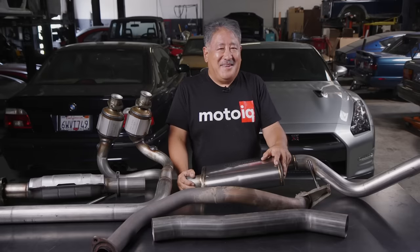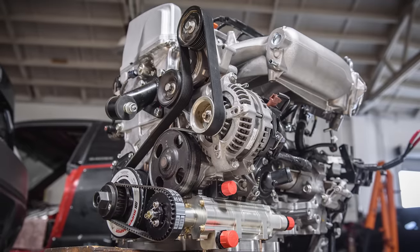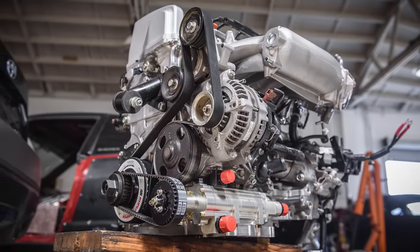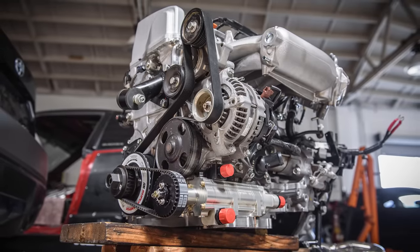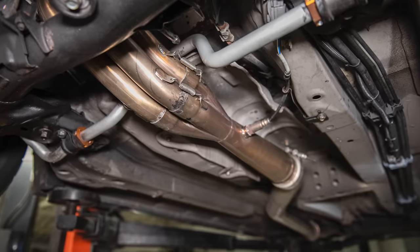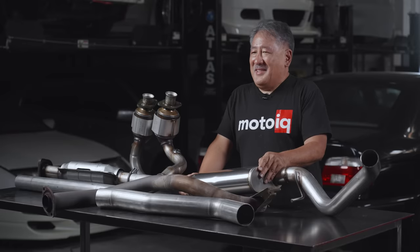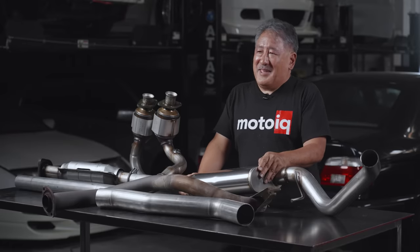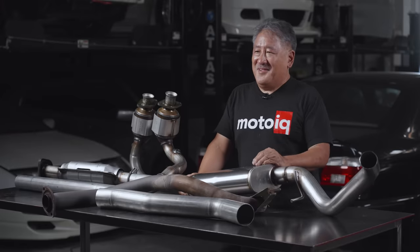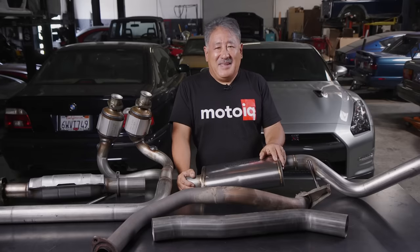How big is too big? It's really hard to say. If you have a highly tuned engine built for good volumetric efficiency — particularly naturally aspirated, like a Honda K motor — it's going to have a big cam on the high-RPM side, VTEC, and a lot of overlap. This engine is super sensitive to back pressure, so you have to have at least a three-inch mandrel-bent free-flowing exhaust, or the engine will lose all kinds of power. That might seem huge for a naturally aspirated two-liter four-cylinder, but it's kind of the minimum needed. Any more back pressure and you get reversion in the cylinders — incomplete scavenge, hot exhaust gas left in the cylinder, poor cooling, and detonation.